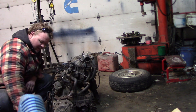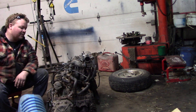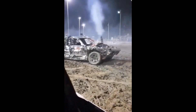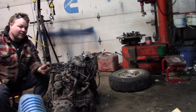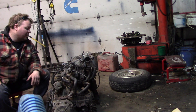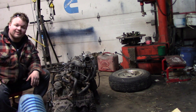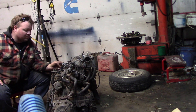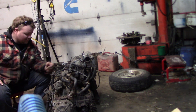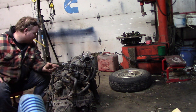What we're going to do now is change the timing belt because this one has melted from sparks. Then we're going to put a new crank pulley on it because again there were sparks. Pretty much we're just going to try to get this thing to run and probably throw it in the car. I still need to put a wiring harness on it because I stole one off this motor. Coil packs are still there, starter still there, transmission feels good.